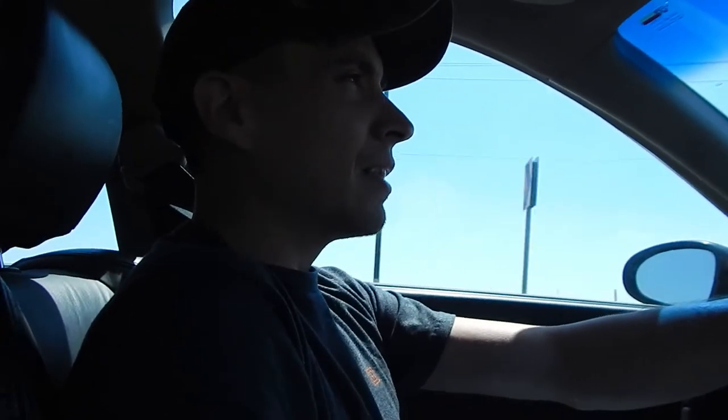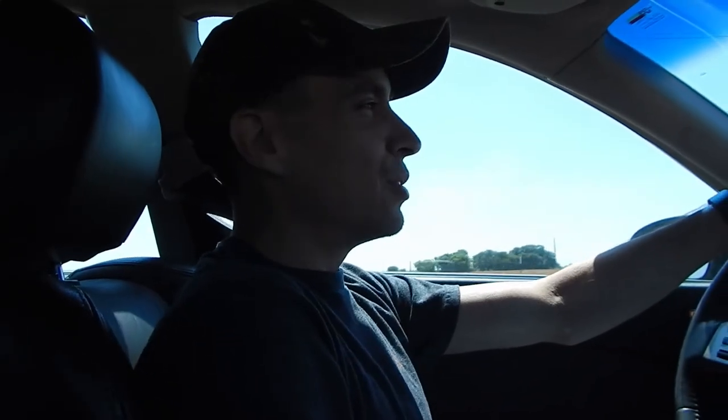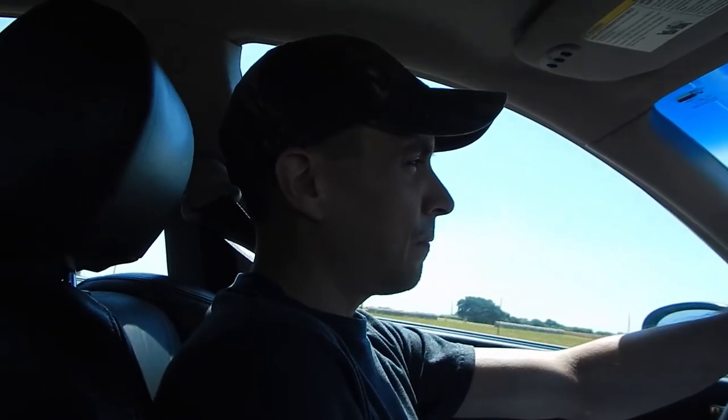I did get just a tiny bit of air out of the passenger side rear. A little bit more air came out on that last set of going through and bleeding everything again. So we are good to go. I guess the mistake that I made in this video was just reinstalling the calipers back upside down, but what did help me out with bleeding the brakes ultimately was those speed bleeders that I ordered. So those helped out a lot.